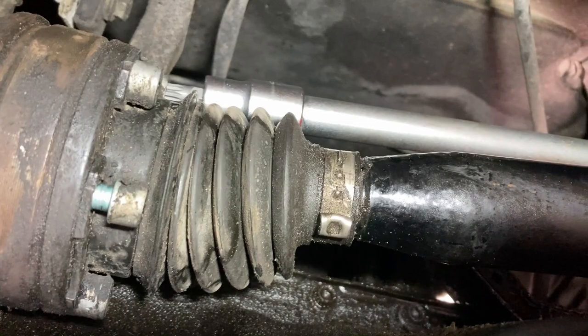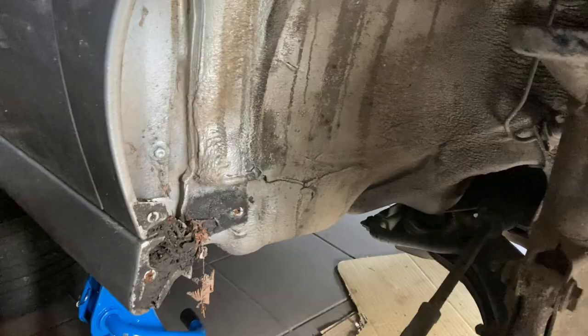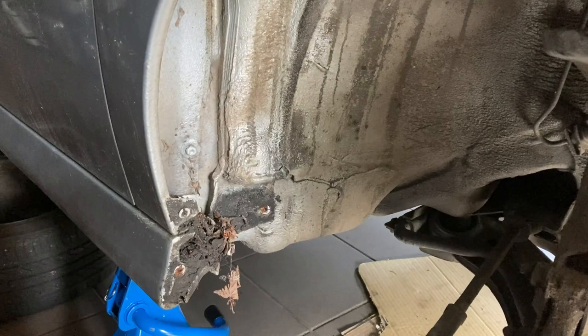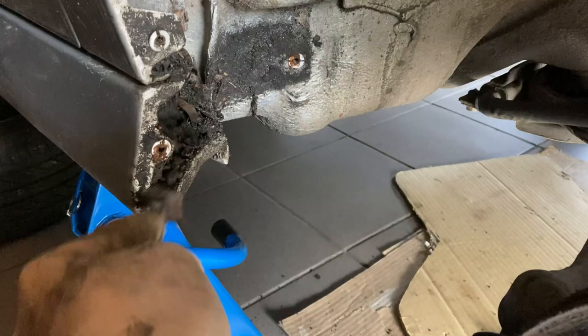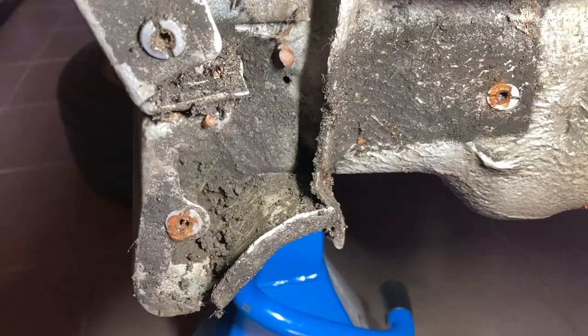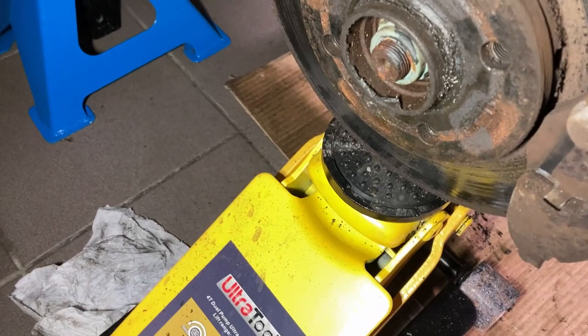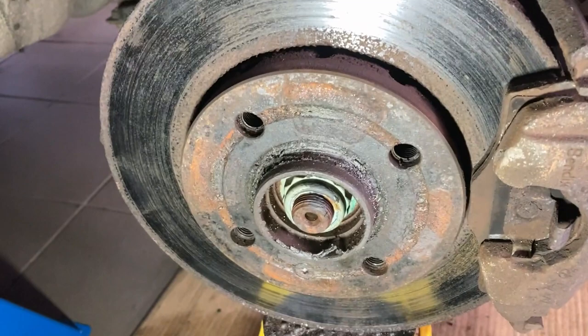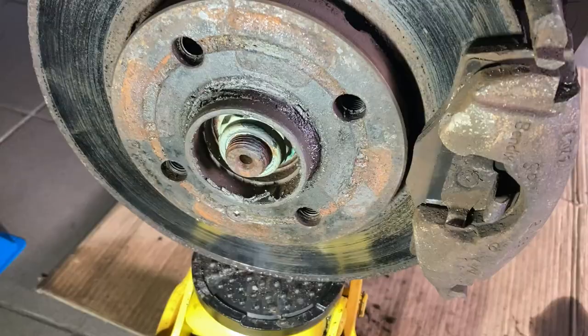Testing things — so far I've managed to remove one screw. What works is basically lifting the wheel from there, compressing the suspension from that side, and that gives enough clearance to remove one of the screws. I also decided to remove the wheel arch cover. I need to fix the wheel somehow, because the rotation from the wheel won't allow me to remove all the screws — so I'm just compressing the suspension. In this situation, this is the best I can do.